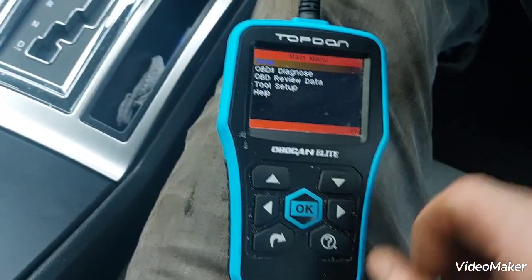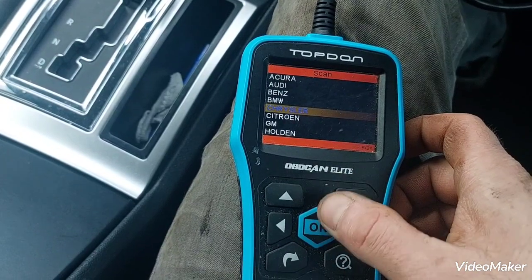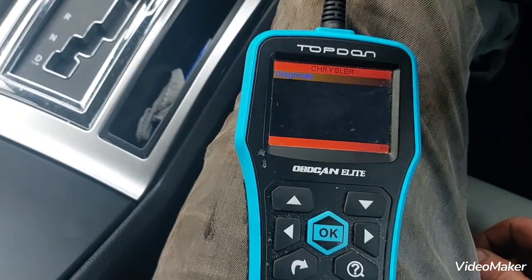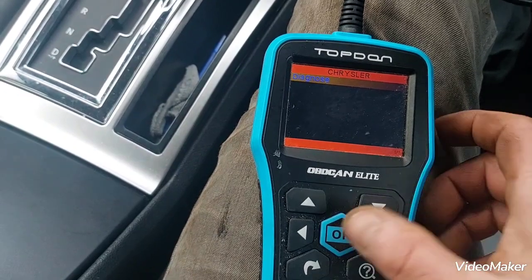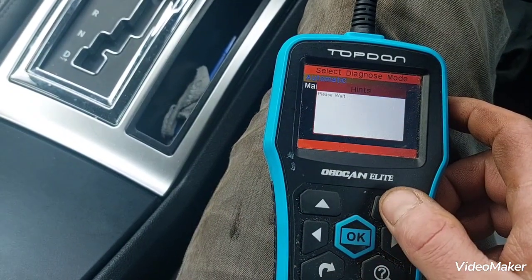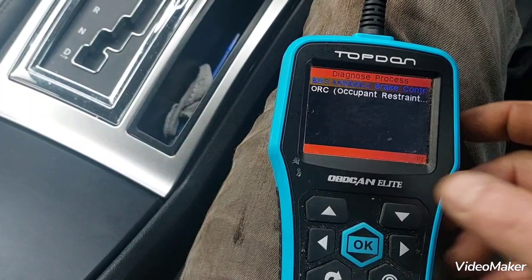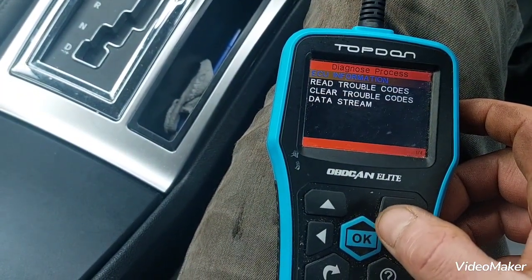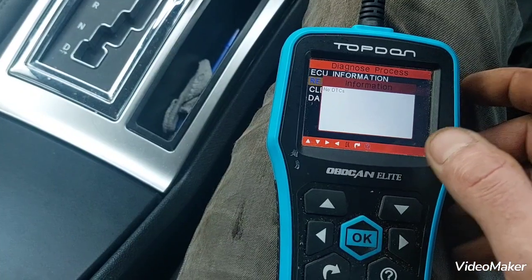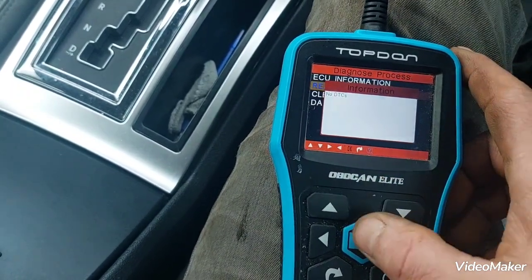All I have to do now is just check that sensor and that wheel for rotation. It's basically the same way how I discovered that wheel is the issue. System scan, automatic. This is a section that does ABS. Trouble codes, no DTCs. That's what we found out after we replaced the sensor itself. But then it still didn't work because it was the ring that was the issue.